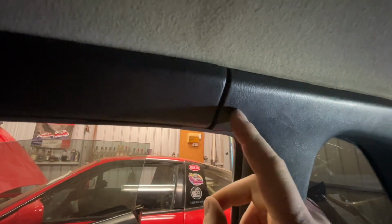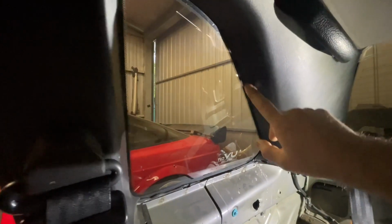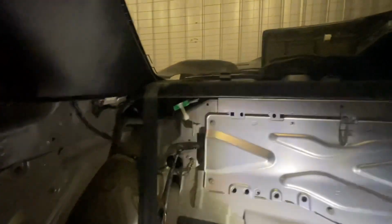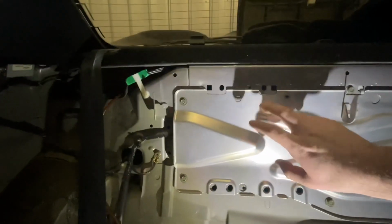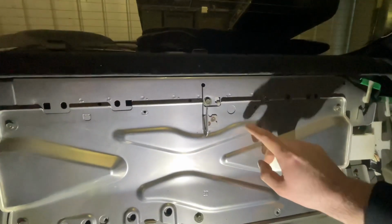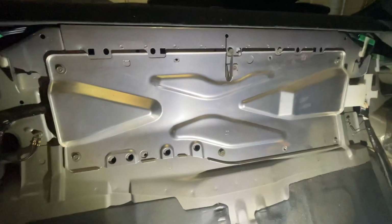You can even see that movement. So there's a fair bit of noise there. So yeah, there's a lot of vibration up in here. So that's another thing. And this plate on the back here is missing a fair bit of stuff. So there's a bolt there that's missing, one down the bottom here, another one there, and this whole thing makes a fair bit of noise and it gets more noticeable over here. So yeah, that's as simple as just putting all the bolts back in. So yeah, for the sake of a couple of M6 bolts, it's quite annoying.